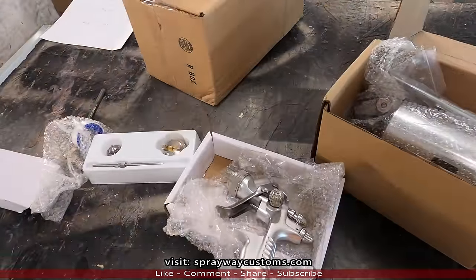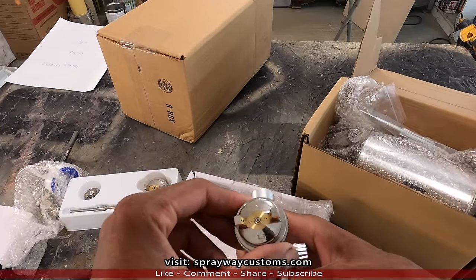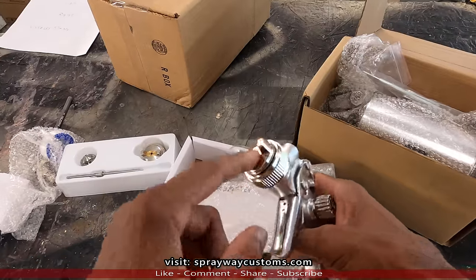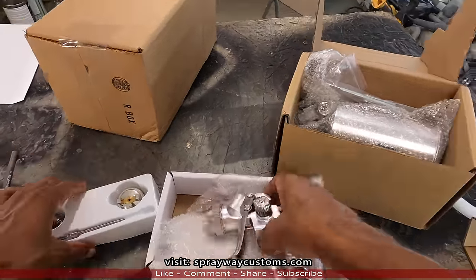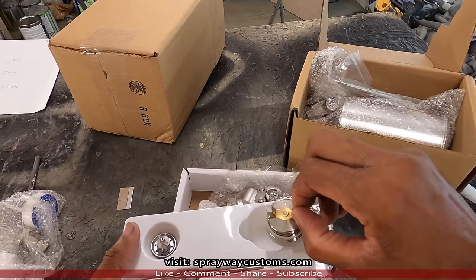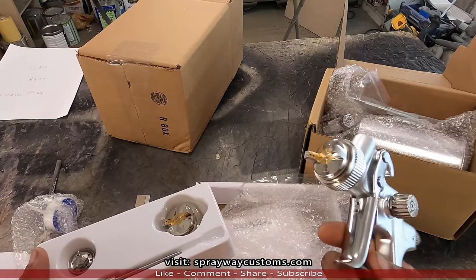Had to cut y'all back on again. I didn't realize it had a cap already on the gun, which I was looking at the gun, but the cap on the gun is 1.3. So we good on that. They just send you an extra cap, because like I said, 1.7 is good for priming. So we got a 1.3 on the gun.